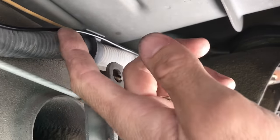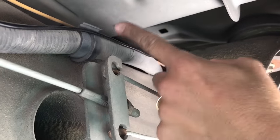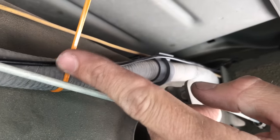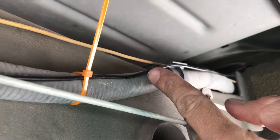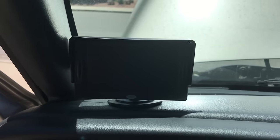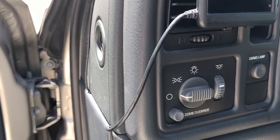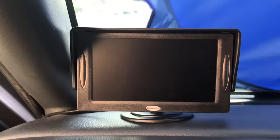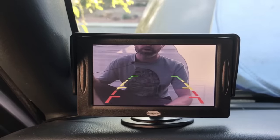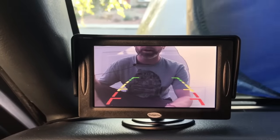Every car you work on is going to be a little bit different, but make sure you tuck your wires up out of the way so they don't catch on anything mechanical. Use zip ties along the way to anchor them. Be sure to keep wires away from moving parts, suspension, and the hot exhaust. Choose the best place to put your screen, run it through your dash, conceal your wires, and tuck it all up — you'll be good to go. Now when you throw your truck into reverse, your backup camera is going to come on. If this video helped you out, be sure to click that subscribe button and give a thumbs up. All these products are available in the description below, and you can do this whole job for about $30. Thanks for watching.